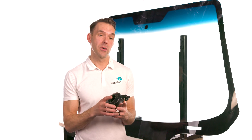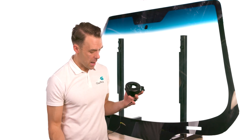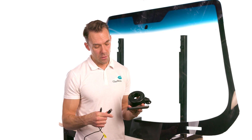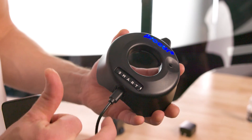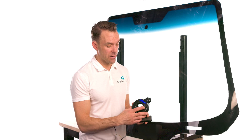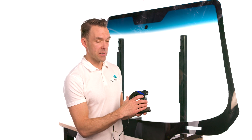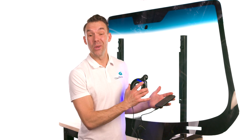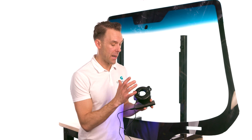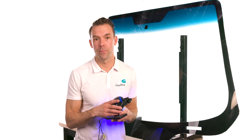A unique feature of the ProCure Smart Light is its ability to run full curing cycles while connected to a power pack. If you forget to charge the battery, plug a power pack directly into the light — this will both charge it and power it simultaneously. Press the button once in the unlocked position and it will run a curing cycle drawing power from the pack. Even in the worst-case scenario, after just a couple of minutes on a power pack you'll be able to operate the light in a mobile setting, so you're never stuck without curing power.